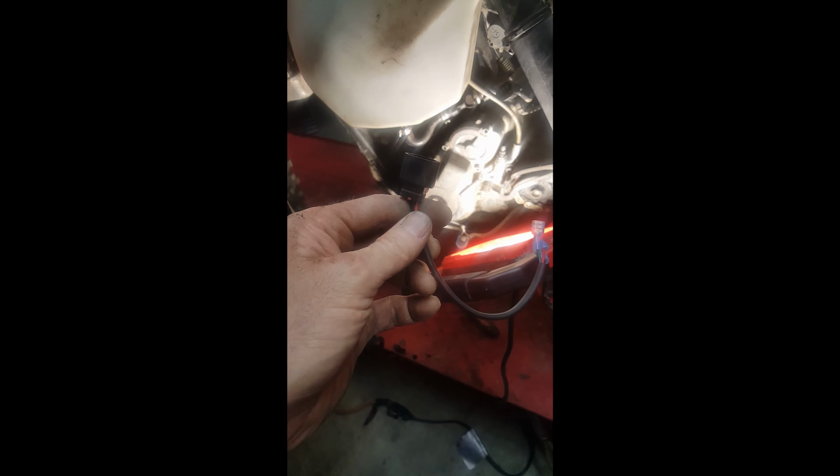and you look at it, you see the end of it. That's the kind of pigtail you're going to look for in all the pigtails I sent you. If you're not sure, you can check the website too. And here I have the matching pigtail. You hook this pigtail up to the TPS, not to the bike. You hook it right into your TPS.